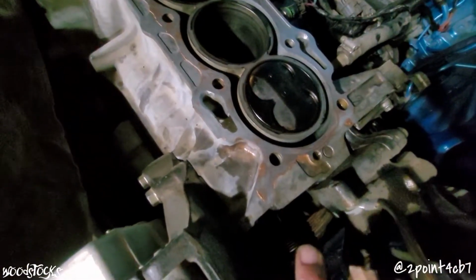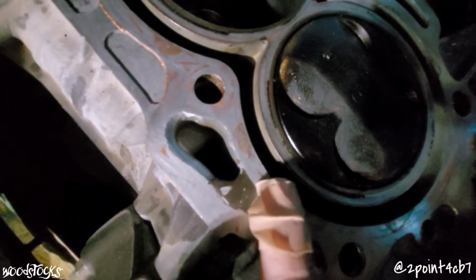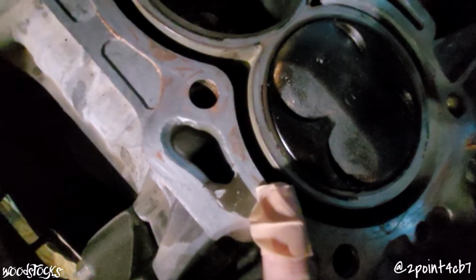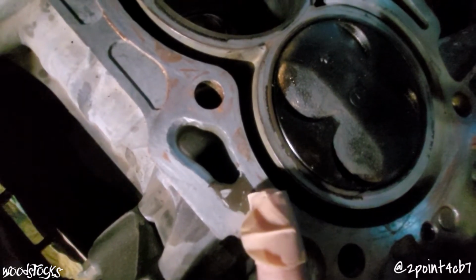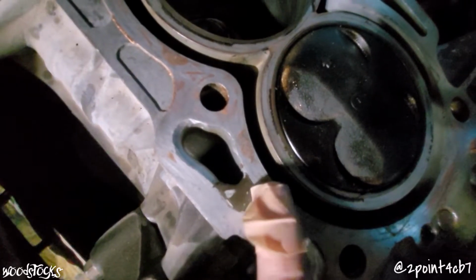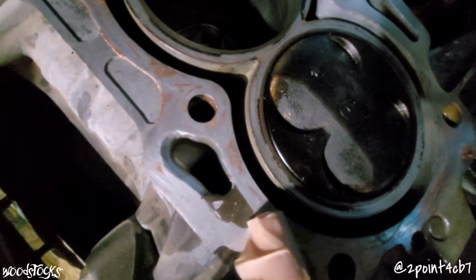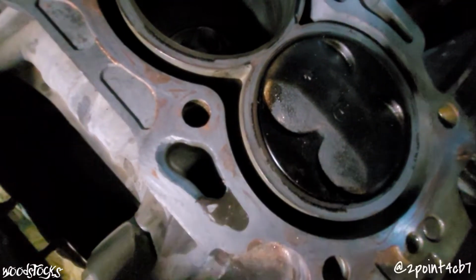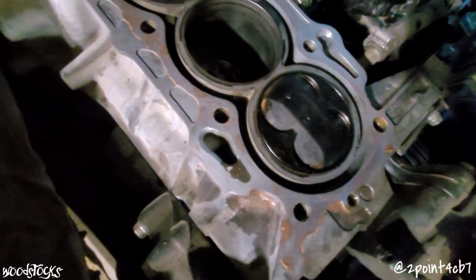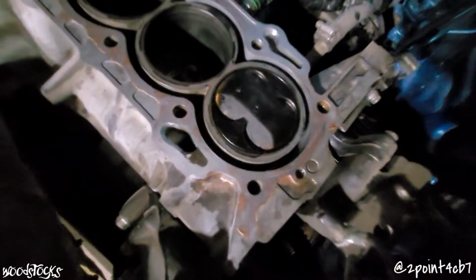During the process of figuring out all the oil leaks in this area, I figured out that this area right here on the drain, on the block, needs to be filled in, whether it's welded in or filled in however you can. This needs to be filled in, or you will end up with a slight tiny little leak just from out of a little corner right here. In the next video, I will show you guys again the gasket laid on top of it, so you'll see what I'm talking about.